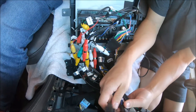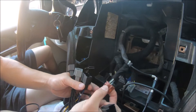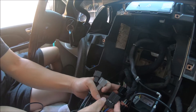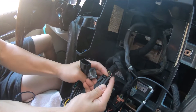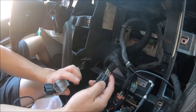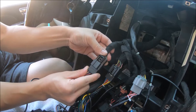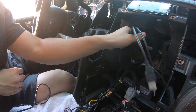With these four plugs: first is the factory backup camera — usually the brown connector here. Connect the factory backup camera along with the center speaker and the subwoofer. For the power connection with the amplifier connector, it goes to the black one — second from the left. You will hear an audible beep, which indicates there is communication between the radio and car. The gray one goes to the gray one, and the black for the OnStar goes to the first one on the left. Once connected, you can see we have several adapters included in the box.